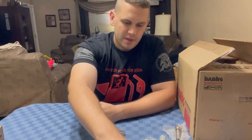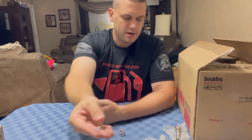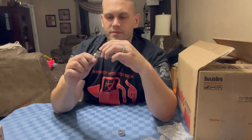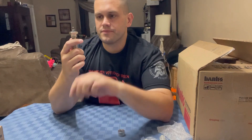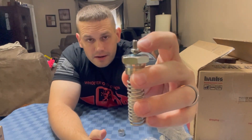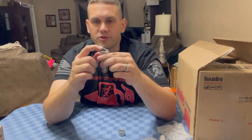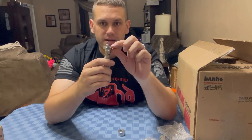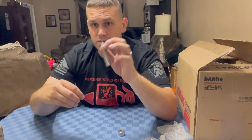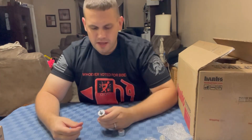There's a bolt and nut in the bag here. This is really important — I saw this in the install video. There is a nut on the heater already installed, and they specifically state do not remove this. If this nut gets removed, the hot lead will come in contact with it, cause a short, and could create a whole slew of problems. So make sure you leave that nut alone if applicable to your model vehicle.